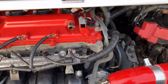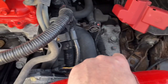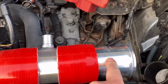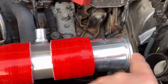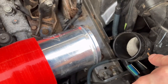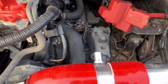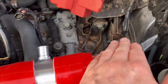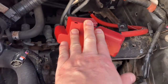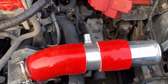So here we go — a range of options has opened up. The PCV pipe needs to go to the PCV outlet; this is a new part. You can then use a coupler to a new MAF sensor tube and then take it down behind the headlight — I'll have to move some wires out of the way — down behind the bumper. The other option is to take a 90-degree U-bend in silicon, have the MAF sensor here and the filter here, and then just tidy this area up. So that's what I'm debating at the minute — I'm in no rush, so stay tuned for part two.